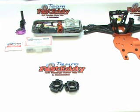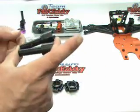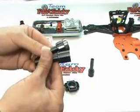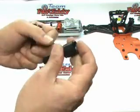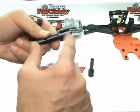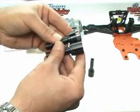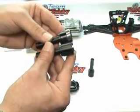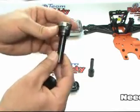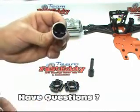We are going to start off by showing you the out drives — these are the axles. The product we're going to introduce at this time is made by Turtle Racing and it is a reinforced drive axle cup. You can see they've added a retaining ring around this. As you start to use them with more engine power, your dog bones are going to end up breaking these off — it happens quite often. Turtle Racing has come up with a product that is second to none for that. You can buy them with their diff kits, separately, or bundled with dog bones as combinations. Go to your favorite fifth-scale retailer and ask for the Turtle products — it's just a beautiful product.